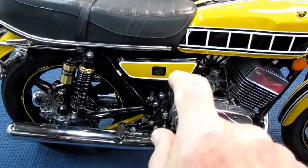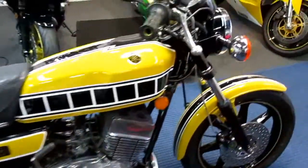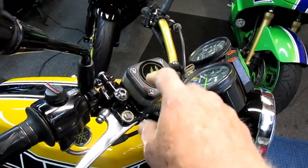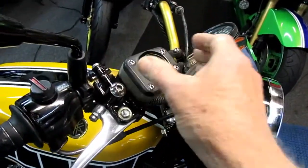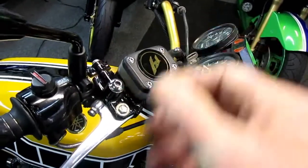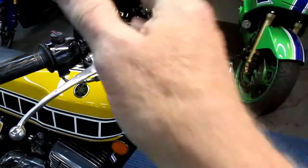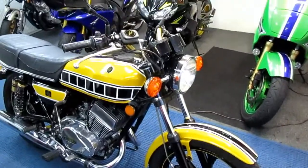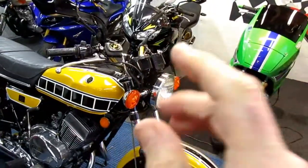When you replace a master cylinder from a more modern bike on an old bike, a lot of times those ratios don't really work out to your favor. On the front of this, I had a different master cylinder at one time but decided not to use it because I didn't want to risk the ratio. Luciano has told me they make reproductions of these master cylinders now. But I just don't like having 43-year-old seals and parts — I like having all new stuff and brand new brake lines. That's the job today.